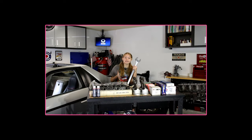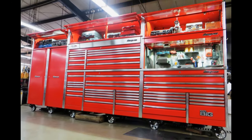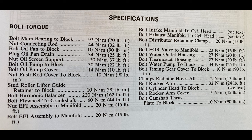In the last video we talked about planning ahead for a successful engine rebuild. The link to that is in the upper right of the video. But what I didn't mention is the tools you're expected to have in order to properly reassemble everything. Some of the most critical tools you'll need include a set of torque wrenches. Almost everything related to the engine requires the bolts to be torqued to a specific setting.